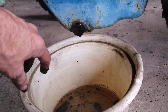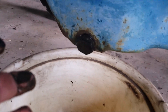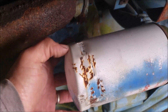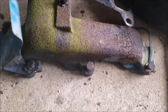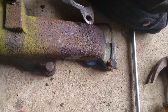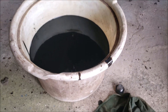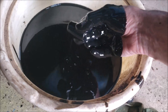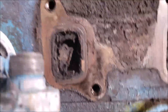Anyway, we're going to go ahead and just keep taking this thing apart because I don't know anything about this engine, so we're just going to do it and see how it goes. I've busted all these bolts - these were 9/16ths. I couldn't find anything to fit one of them so I hammered a half inch on there since 13 was too loose. Finishing getting the exhaust manifold off. Hardest part is going to be remembering where all these bolts went - you either keep them together, take pictures, or label them.